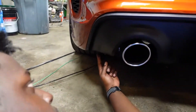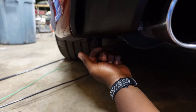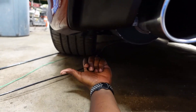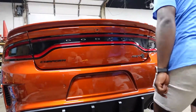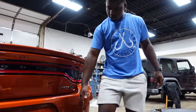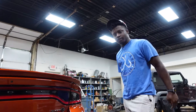Basically all you're going to do is slide this right into that hole, which should line up perfect. Once you do that, push it right up and that locks it into place. Do the same thing on the opposite side, then like I said you have four screws right here in the middle — just screw those in and that's your new diffuser.